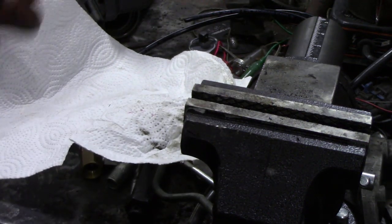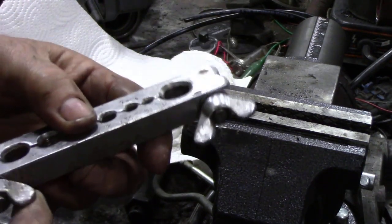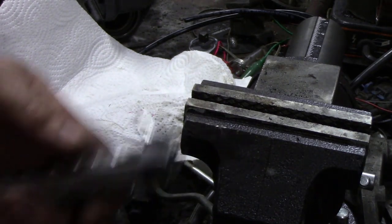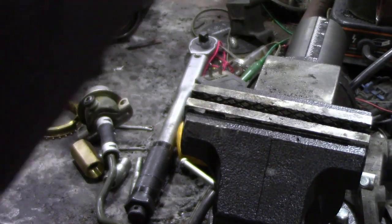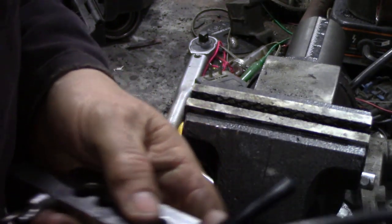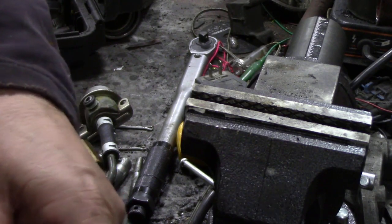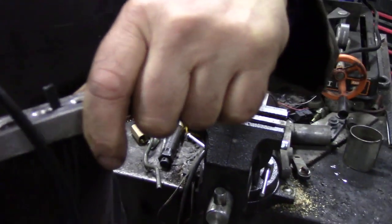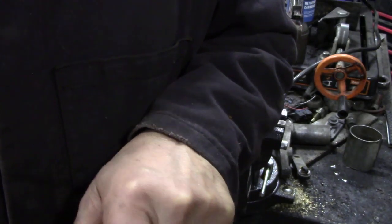Next thing, going to get one of these things here. You get them with those cheapy brake line makers and plumbing things. They're absolutely no good for that, but they're good for this. I think this pipe is 1/4 inch inside diameter, because we can't get metric stuff here. Put your pipe through. I'll have to zoom out a bit here. So put your pipe through just a little bit, because you want to support it.